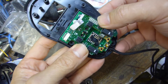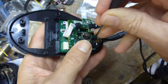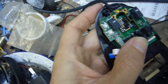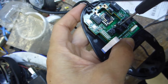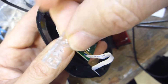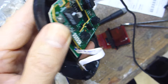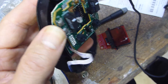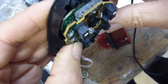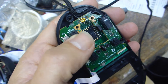Pop all these bits back together. The reason I leave screws in the plastic components is so I know which screws go where. When reassembling, make sure this little plastic piece — which has these tiny little ferrules for holding the springs — goes back in first, because I forgot it the first time around. You can see where that goes. It clips in like that, and there are the little recessed ferrules for placing those tiny springs.